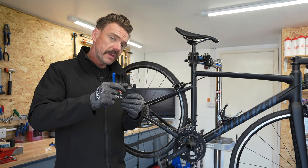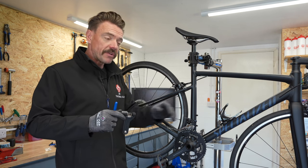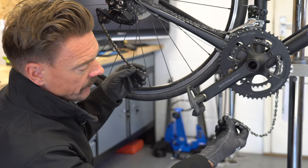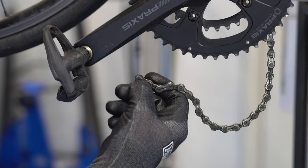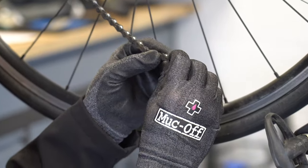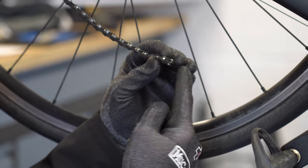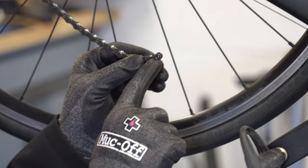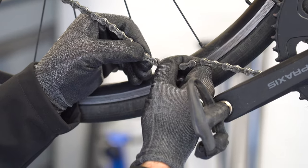The first thing I'm going to do is look at the ends of my chain and work out which ends I want to keep and which to remove in order to install my quick link. Looking at it here, I've got one end where I've got the inner part but the plates have gone missing. And on this one, I can see I've still got the old plates left on with no roller in between. This open-ended section has got to go, because my quick link is going to replace that in order to pull those two pieces of chain back together.